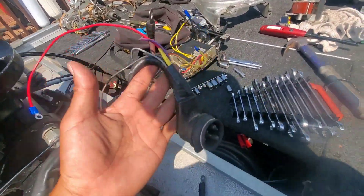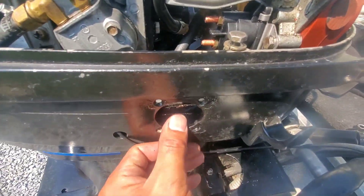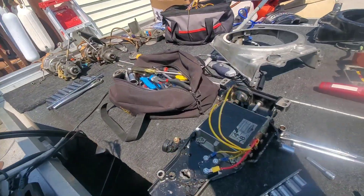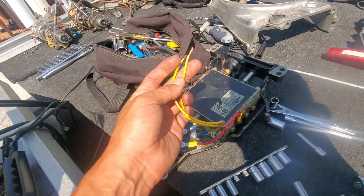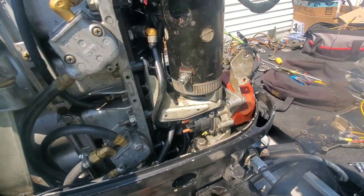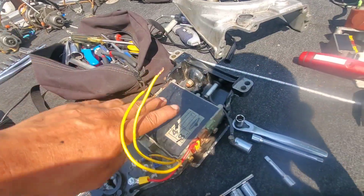So now we're going to install the internal harness that I rebuilt. All the color codes match the current color codes for the new style controller. First thing I'm going to do before I put this through here is install the components onto the solenoid — it's a lot easier when the wires are out. I already got the rectifier installed, the red jumper to here, and the red wire from the harness is going to go there as well. This comes off the stator — these are alternating wires — and these are going to get clamped together. Once I get that done, she should be wired up and it'll be time to put on the distributor. I'm going to have to cut that little piece off right here — that's just your choke mechanism — so the plate can fit, because the box is a lot bigger than what the other one was.